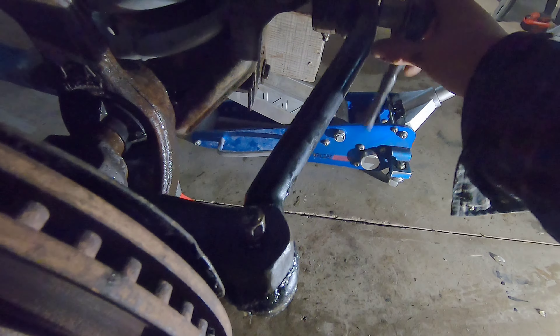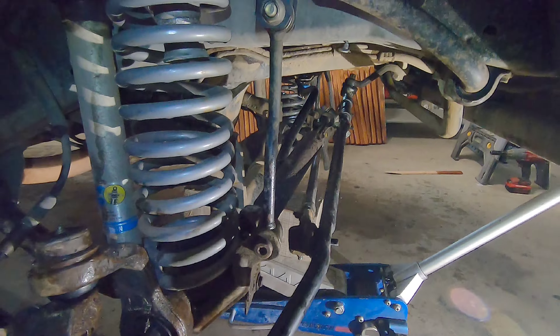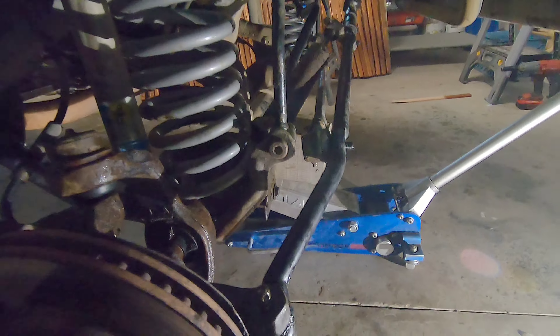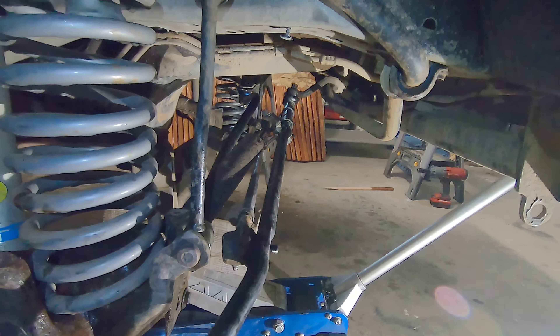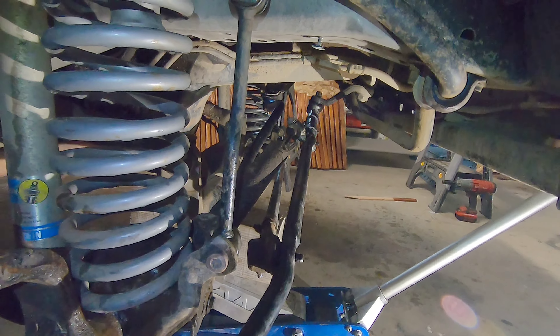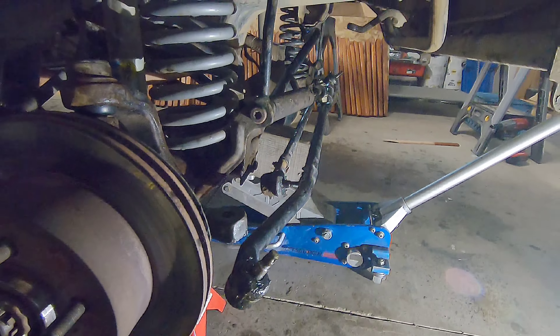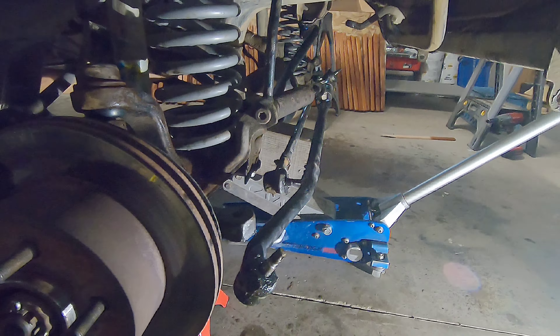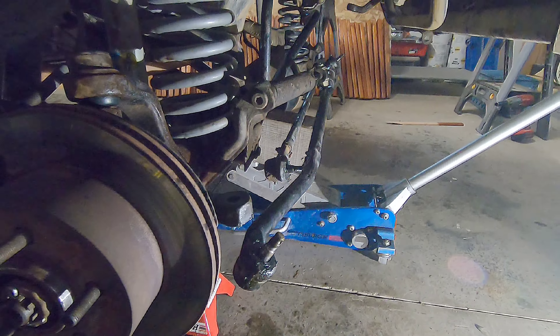I think there's a lower here, and then shocks and springs are pretty much the lift kit, and the sway bar links are ultra long. I got those out. Still got to do the shock and then the bolt on the pitman arm. One hit and they all just popped out, which is pretty odd — tightened them pretty good. But it's only been like 200 miles on it, maybe a little more. I guess it was time to re-tighten anyway.